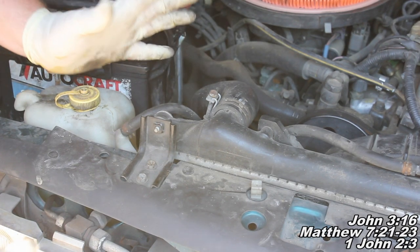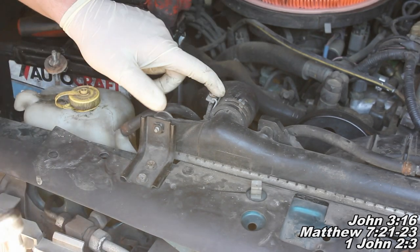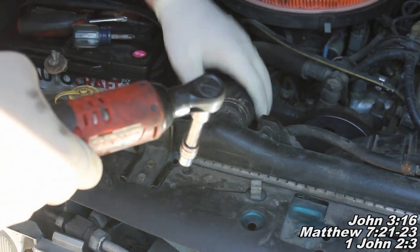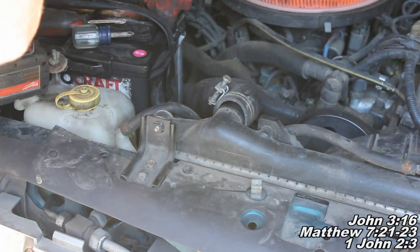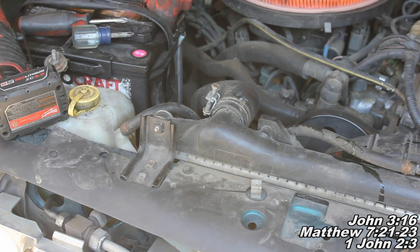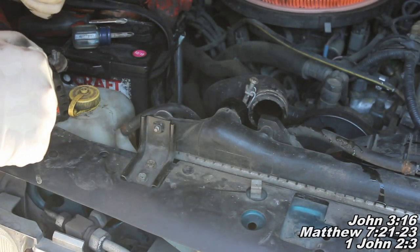All right guys, the next thing we're going to do here is work on getting this radiator hose off. You're going to want to remember to stick a drain pan directly under this piece, because when we remove this hose, we're going to drain a bunch of fluid, and you want to catch that fluid in your catch pan. It's a Phillips head screwdriver or 10 millimeter socket you'll put on here. We're going to loosen up this clamp. And once you've got them loosened up, go ahead and break the connection there. When the fluid starts to come out, I'm going to check here at the bottom. You're going to want to do the same to make sure you're actually catching your fluid. So, there we go. Drop some in. We're going to see down here where it pours out. And there we go. Once you get your drain pan arranged in the right way, just go ahead and take it off and let some drain out. And then, in just a second, I'll show you the next thing you're going to want to do.